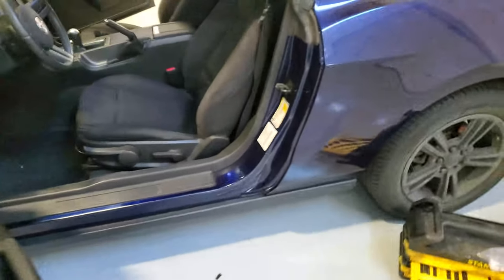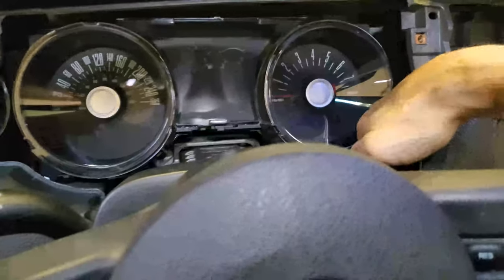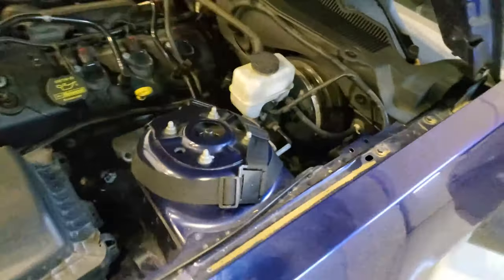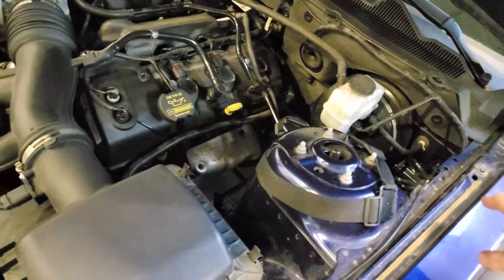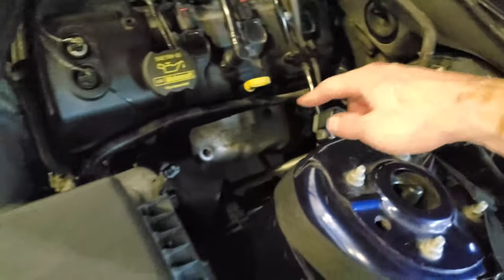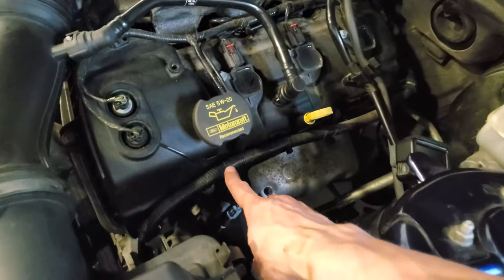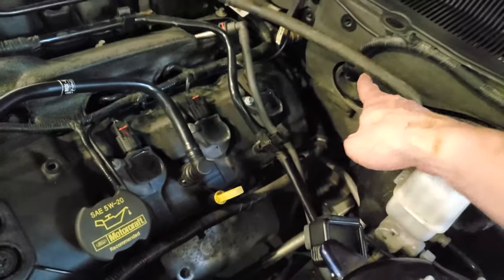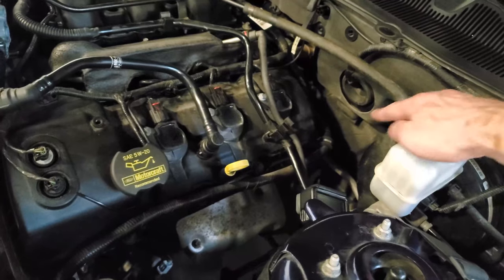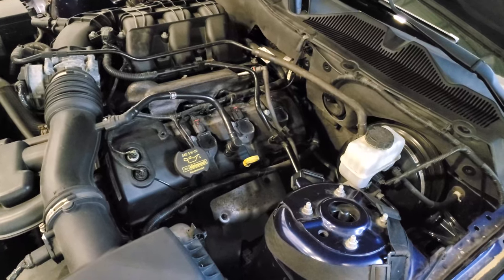This is actually kind of hilarious and sad. Well, just like always, things don't go as planned. This doesn't reach. Yeah, so the cable, how it's routed, does not reach the gauge, so I need to reroute it. Instead of going through the long way around up there and all the way around, I think I'm gonna get up here, follow this harness, then get up here and then get to this grommet. This extra space saved should be enough to reach the gauge itself.